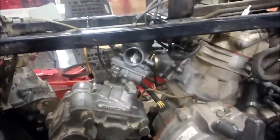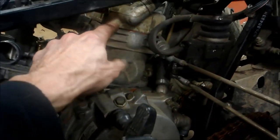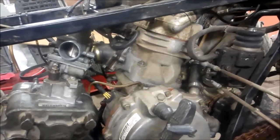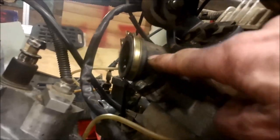So what I'm gonna do - I already got the carb off - I'm just gonna pull the jug off from the bottom base and pull the four nuts off, slide the whole thing out. I'm gonna test it with the head on to see if the head is what's actually leaking. I want to find that out - I'll be able to get a glimpse of the piston right away. It's in tight quarters so you're not gonna be able to see it with the camera. I'm gonna take the ground strap off, these bolts off, that mounting bracket off, and take my carb boot off.